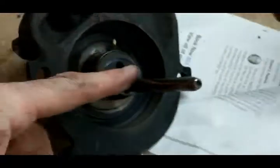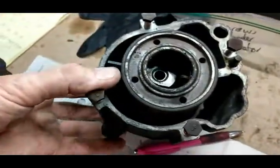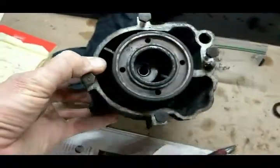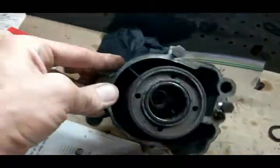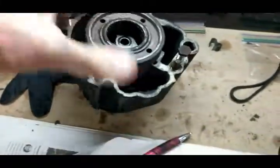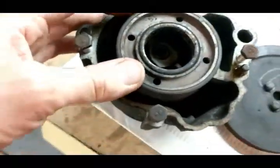The pulley's fine. I took the back off — the inside is pretty dry. It was working but very noisy; the shaft needs to be oiled. What I'm going to do is see if I can take the vanes out, but if I can't I'll just oil it all up and put it back on and let it run. Otherwise I'd have to put an idler in there, which feels like more work. Let me get a light on it.